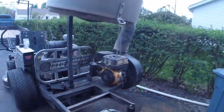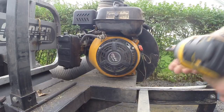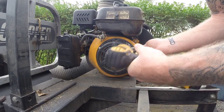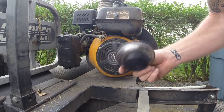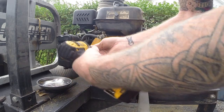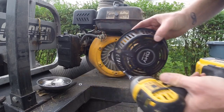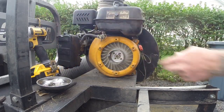You can see that he pulled the cord right out of there, so we'll take it off. It's just some 5/16ths to take that housing off, and then I can show you real quick how to rewind one. It's not difficult — it's not a hard job — but some people just don't know how to do it. I always use an impact; it just makes things a lot quicker. You can use a ratchet too, not a big deal. I also always use a magnetic tray — this is just from Harbor Freight, they're cheap. I think this was actually one of their free coupon items. I use it to keep everything secure. That's what it looks like with that off, and you can see the cord broke right at the end.